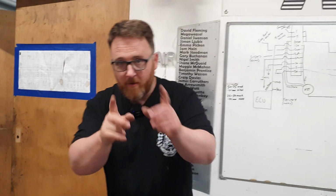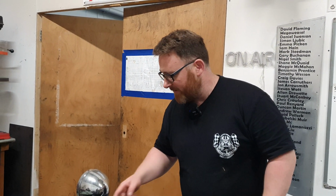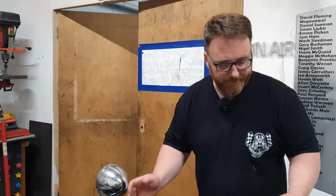Obviously the airflow meter is just taped. So that's another thing about the airflow meter. The fuel pump will not work unless this gets a reading. The only way it's going to get a reading is if a vacuum pulls air by it. So if this wasn't connected, you wouldn't get a pump. It doesn't automatically come on in an MX-5. It is activated by that, which is a good safety feature when you think about it, because if that isn't drawing air, your fuel pump shouldn't be running anyway, because the engine's technically not cranking. It's just a bit of a strange way of doing it. And if you don't know how to do that, you're going to get stuck, because you won't get fuel. Because most of your normal cars are just the usual, you turn the key on, it'll just do it.